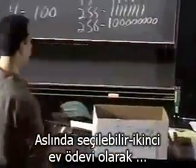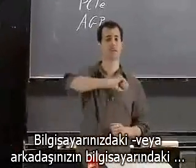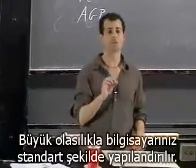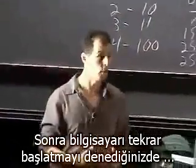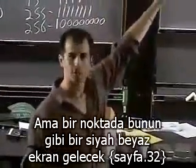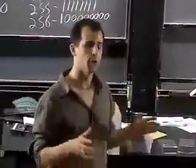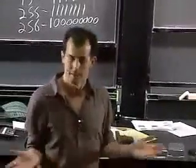In fact, as a second optional homework assignment, what I would challenge you to do if you have PCs is, when you've disconnected everything from your computer, or your friend's computer, plug everything back in except for the keyboard. And most likely, if your computer is set up in a standard way, when you then try to boot it up, you'll see not necessarily the pretty Dell logo, but at some point you'll see a more black and white screen like this and an error message saying keyboard not present. And sort of the irony is, and this is literally the case on many older computers, you will get messages sometimes saying, keyboard not found, press F1 to continue.